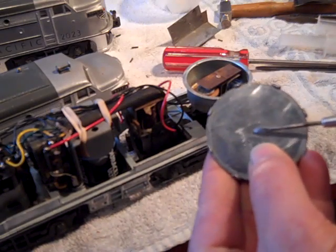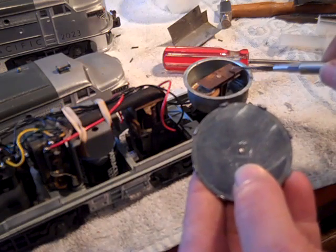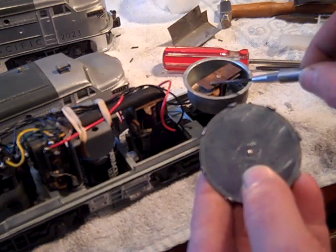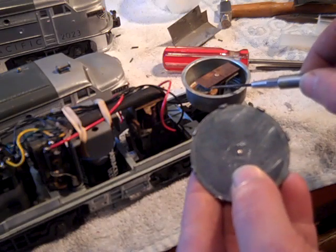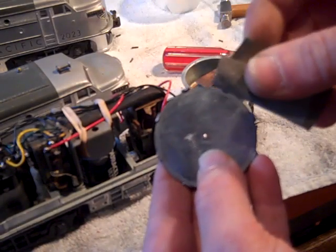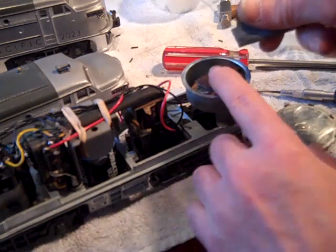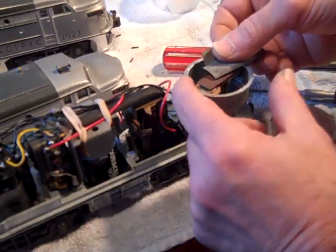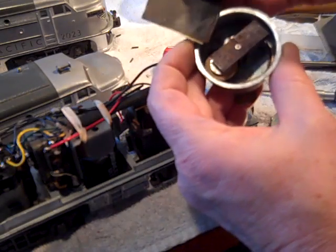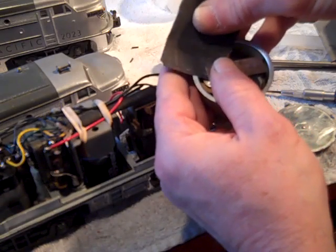What happens in these horns many times is this little contact gets oxidized, this contact gets oxidized, and this flapper arm — which is sort of rusty in this one — can be made to work again. The surface between the magnetic plate and the contact gets corroded and makes for poor contact. So I've taken some 400-grit sandpaper and polished off the top contact on the horn, and I used some 320-grit to polish off the underneath of this contact here.